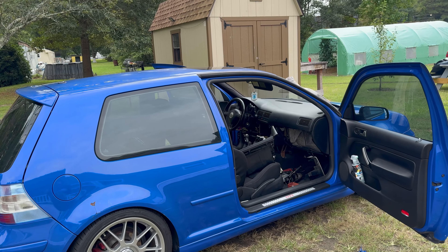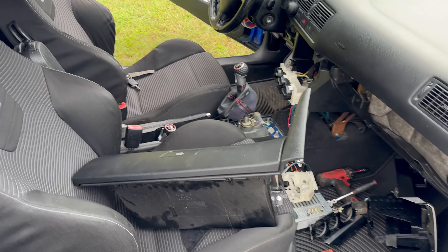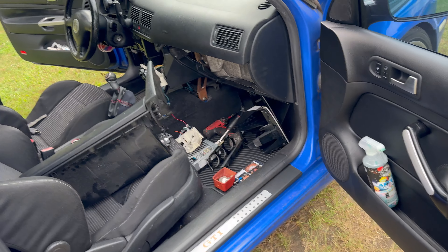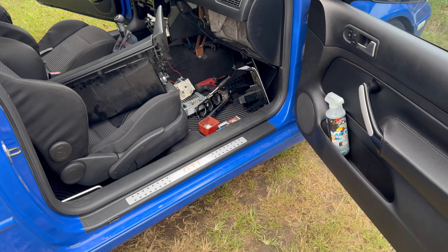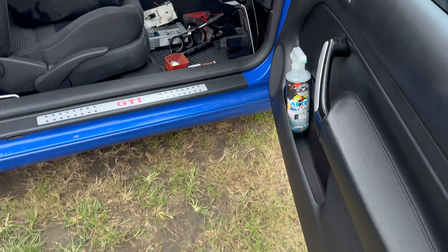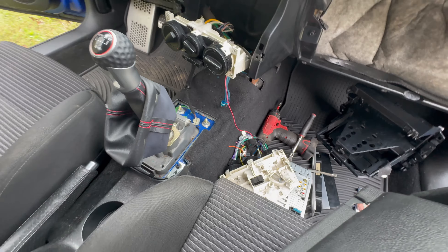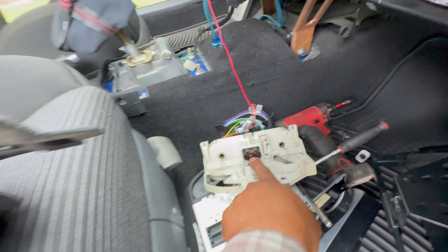Welcome to the channel, this is Taco Valve. Today I'm trying to finish this car - last night a buddy of mine brought me this car to check on the air conditioner because it was not working. This is the 20th anniversary model. I had to tear up all the plugs and everything to see if we got continuity, and I pulled and tested different AC switches.